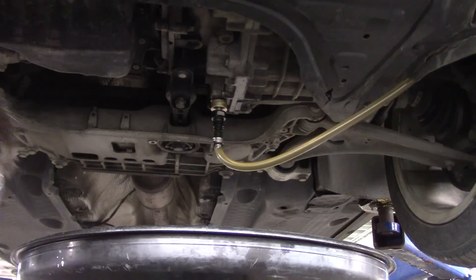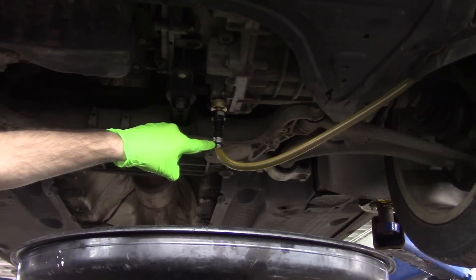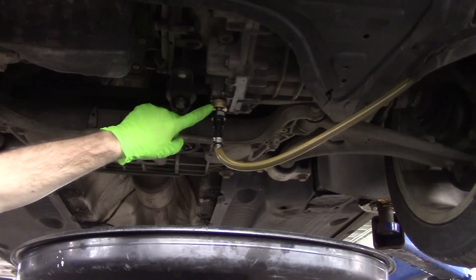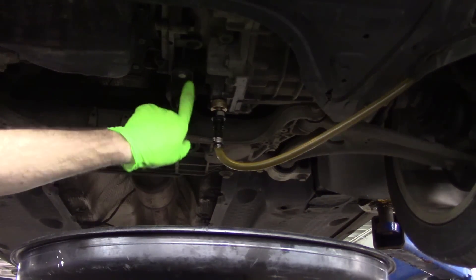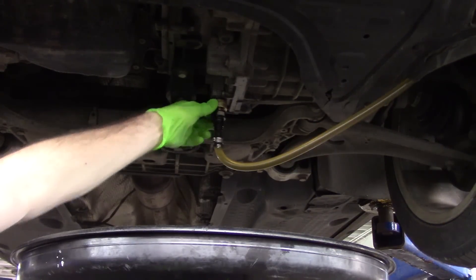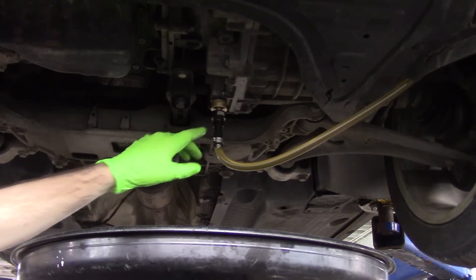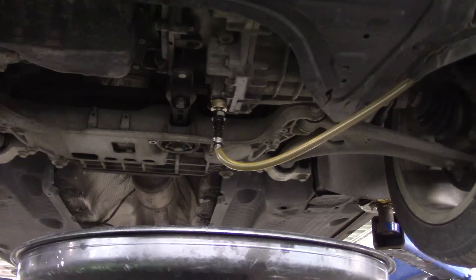Okay, so you want to have a drain pan ready. Right now my tranny fluid temp is 26 degrees Celsius. You can see right here — here's the tube where the fluid's going in, and right here's this little adapter. I'll put the name of it in the description. Inside the tranny there is a fill tube that threads in — I believe on this one it's an 8mm Allen. So in theory if you were draining this transmission fluid, you'd pull the drain plug, it drains out, then you pull this fill tube out to drain the rest of the fluid. Pretty much what we're going to do is overfill the tranny, let it get to temperature, and drain it until it gets to the top of that fill tube level — that's how you set the fluid on here.